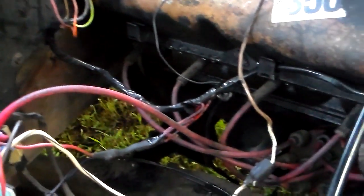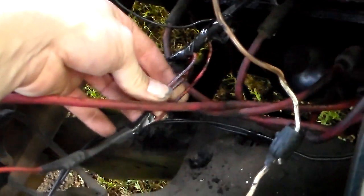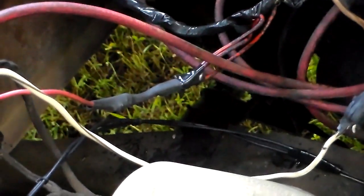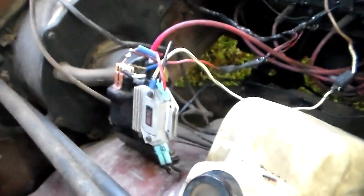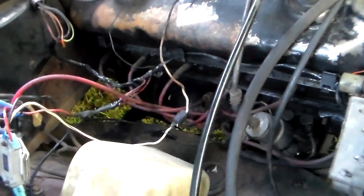After you start parsing these wires out, you've got the red wire coming from up there, it comes along to about right here. Then you have another red wire that goes to the alternator, and then one that goes to the choke heater and oil pressure switch, which I'm not going to use because I don't even have a choke right now. What you're going to have left is three wires right here. I soldered an extension onto it and I'm using that to power my coil, put some heat shrink over it, and I've got some conduit to put on it too to keep it nice and safe.